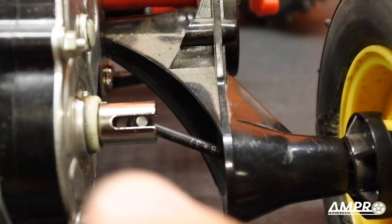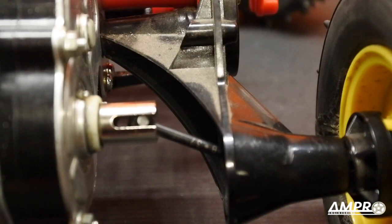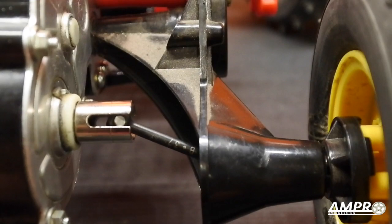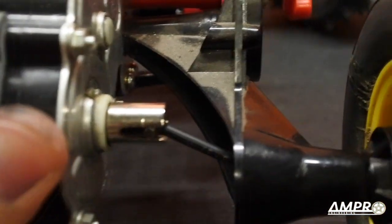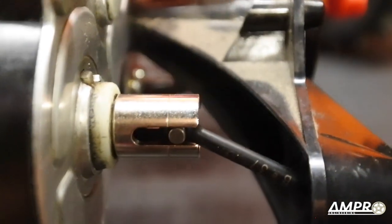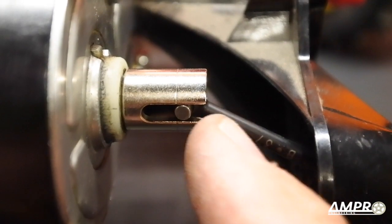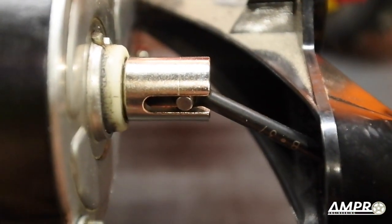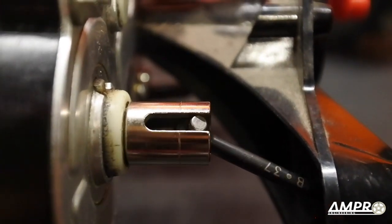What I've been reading is that oftentimes these axles will pop out. It's less prevalent with the dog bone style, as we'll see in a minute, but on the CVA style it will pop out. If I put the axle horizontal so the pins are pointing directly at you, you can see that from the center of the roll pin to the outside of the drive cup you're looking at about three and a half millimeters — that seems pretty adequate and it's in there quite nicely. But things change when you rotate.